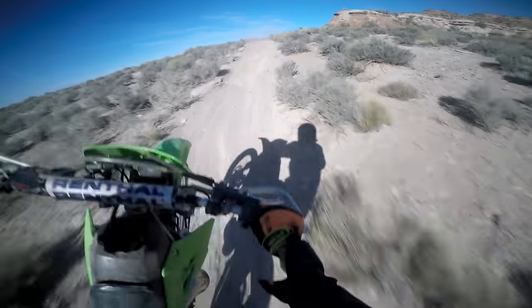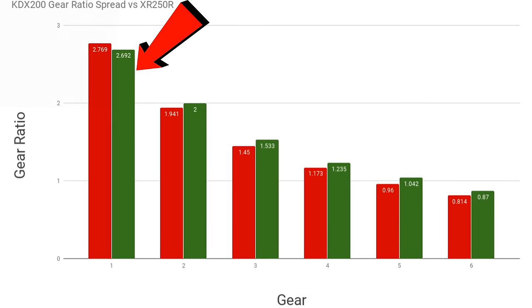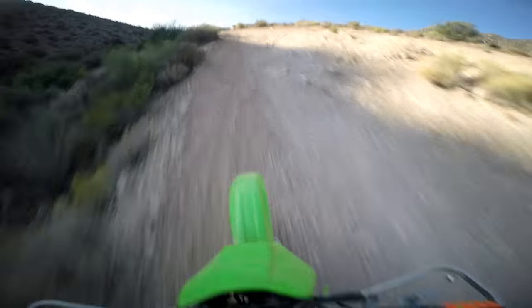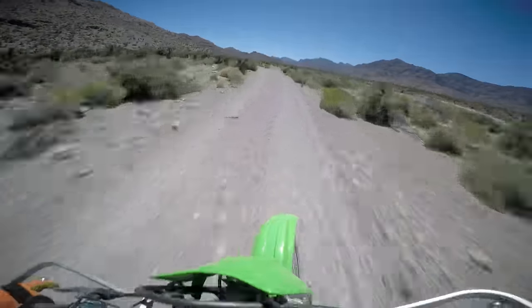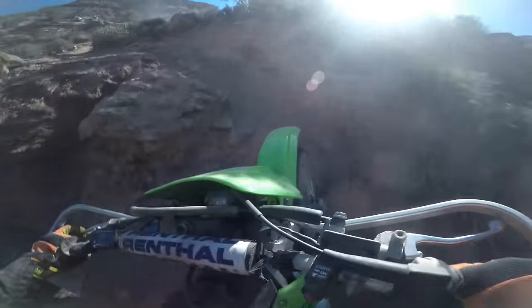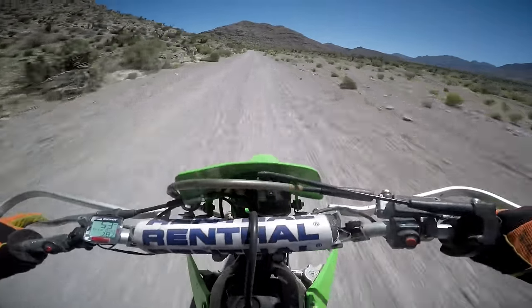The transmission gear ratio spread is a medium-wide ratio setup — closer ratio than my XR250R, with about a 3% taller first gear and about a 7% shorter sixth gear. That spread works well for the KDX: close enough transitions between gears to easily keep it in the strong power, but enough spread to keep first gear a crawler while having plenty of high-speed potential in sixth. That's the beauty of a no-compromises six-speed transmission out here in the desert.